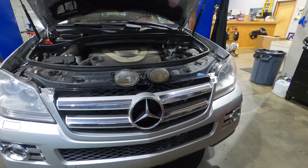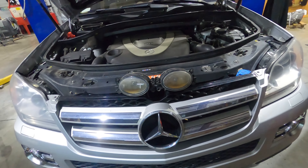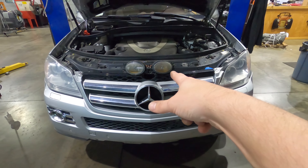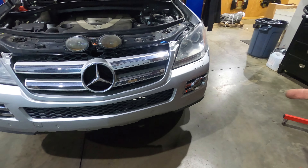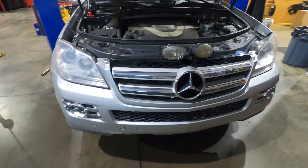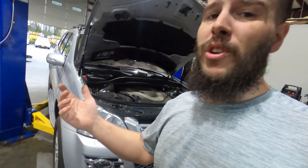I don't really know if that's the proper adjustment just because of how bad the old ones are — they weren't putting out light I could use to adjust with. But I will get these adjusted now that I have new ones that actually work properly, just park against a wall and make sure the adjustment — which is more left-to-right than height — is lighting up the corner it's supposed to. The new ones look 10 times better than the old ones and hopefully will give me the light output while cornering like they're supposed to. If you guys have any questions please comment down below, subscribe to the channel, and I'll see you later.